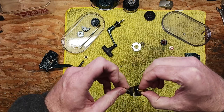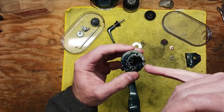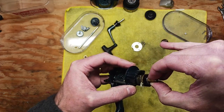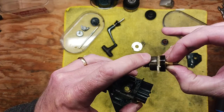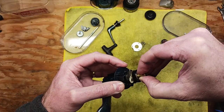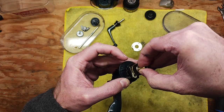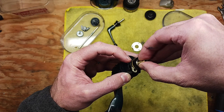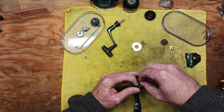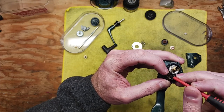Don't forget you've got that small spring that needs to go back in position here — it's easy to lose, so just take your time. You want to make sure you clean up the housing really, really well, get all the old grease, dirt, grime, anything in there out. Then when you go back, there are two slots on either side that need to line up with two slots in the housing. It'll make sense when you're working on it. Be slow and careful, gently slide down into position, and push that spring in as you're doing it so it slides into the trough that holds the spring in position.